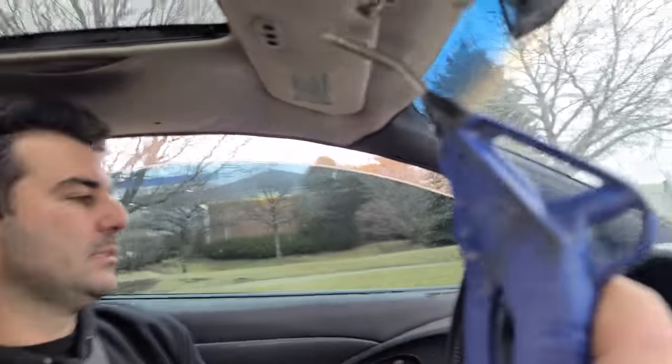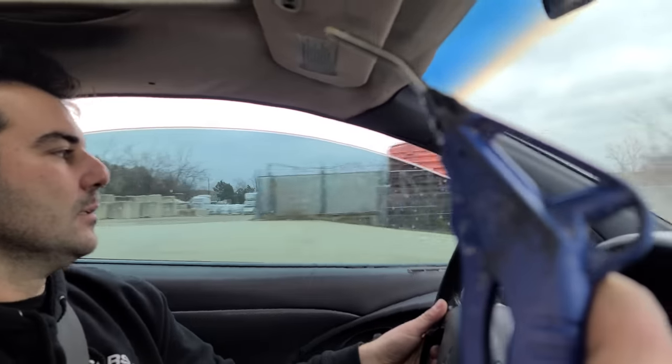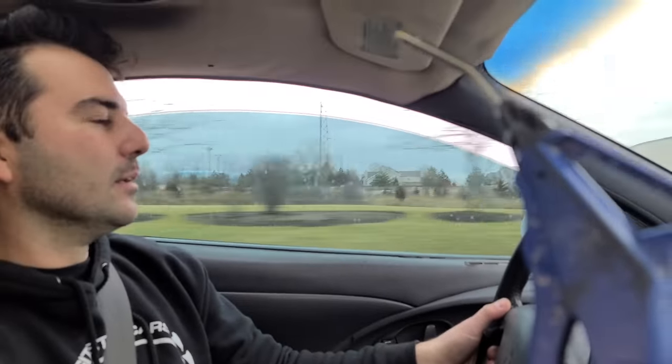At that point, we are bleeding off all of the wastegate actuator's boost reference. It'll go to either the most amount of boost that this turbo will create, which is a lot. Now the exhaust is just going to push on that wastegate spring and potentially open it. So we still will be limited to a certain degree. So go ahead, wide open throttle, Peter. All right, you're wide open. Let me watch the boost. Yeah, we're just getting about 13. It's like a 3 PSI boost of boost.